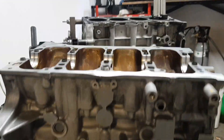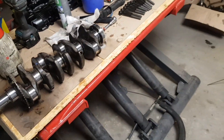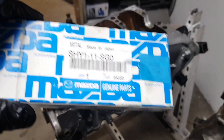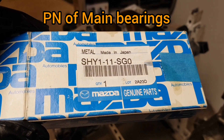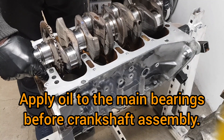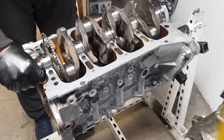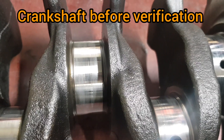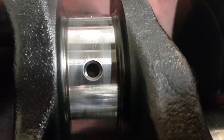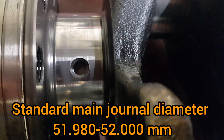Here we have the crankshaft with its nominal dimensions. The nominal dimensions of the crankshaft main pins, crank pins and others will be included in the video. Here is the crankshaft right after removal — those greyish stripes remained from old bearings. I removed most of them with a strip of sandpaper at 3000 grit and then measured them with a positive result.